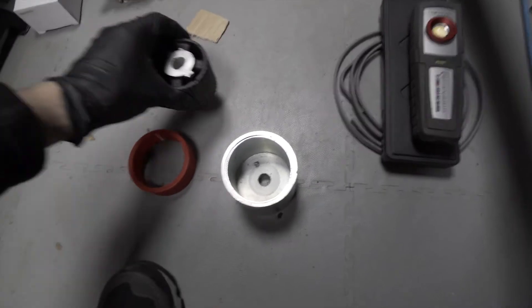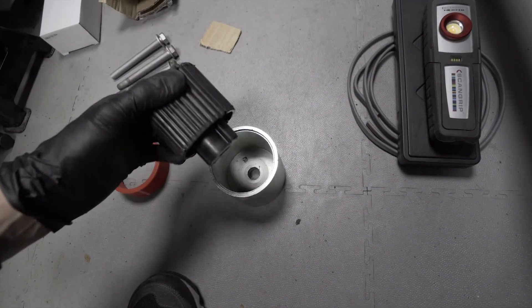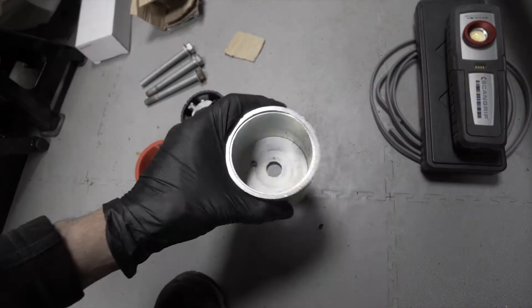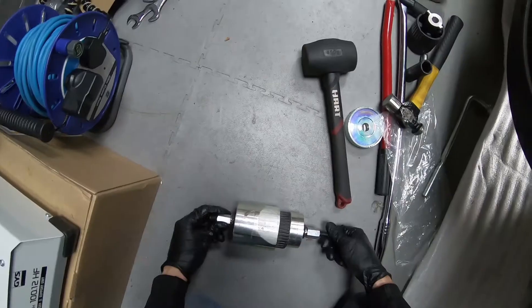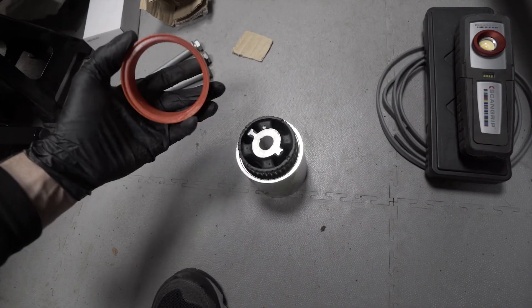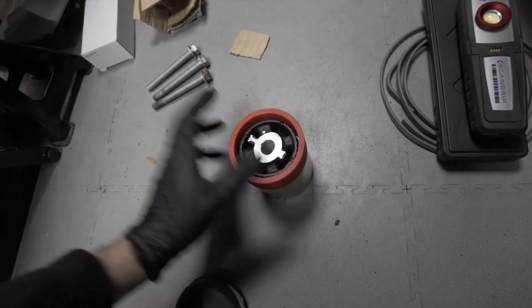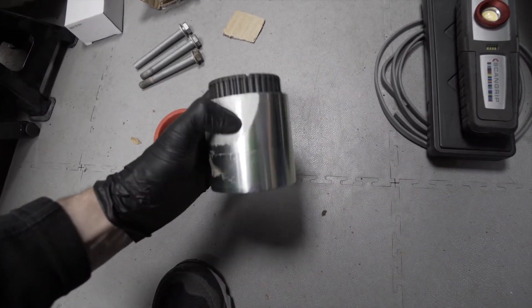To extract it, I'm using an extractor I found on eBay. The only issue with it is that this extractor is for older models — I think it's for the X5. I will put a link and give more details either later in the video or in the description. The difference is that this extractor is too short. I already took out part of the bushing and tried to hammer it out, but it really doesn't want to go out. So I went ahead and 3D printed an extension, and now we should be able to take out the bushing completely. The difference was a few millimeters — maybe 25 to 30 millimeters.